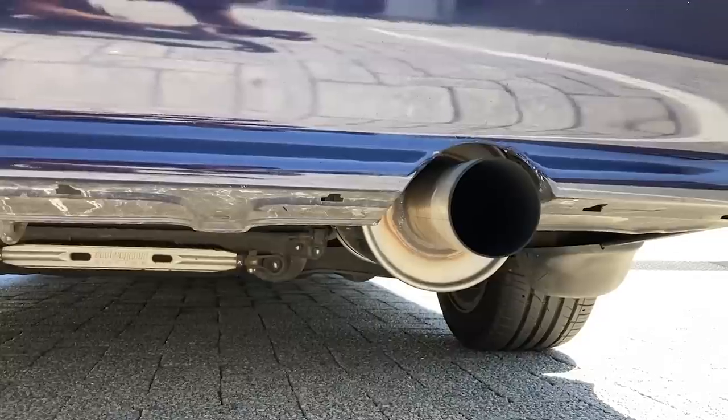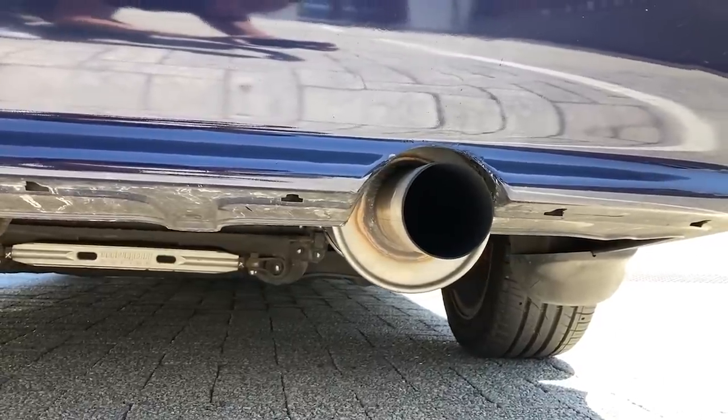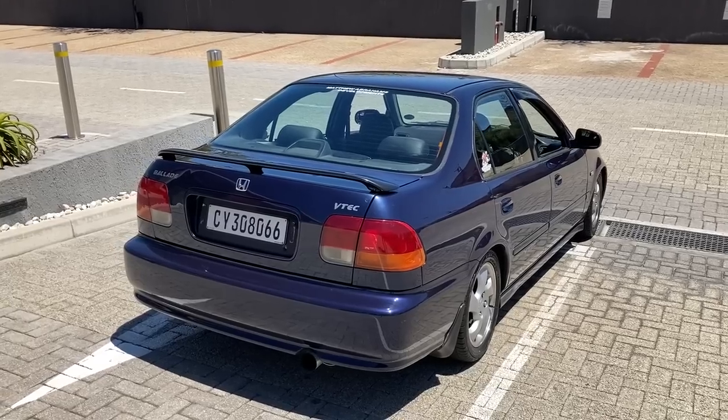Spinning, and that's a thumbs up for Z-Line. I took the car to Harith GSD and he did my road tune. So after my road tune, I fitted the speed box and I went for a power run again. So the car was doing 134 kilowatts, and it gained 4 newton meters of torque. So it was 134 kilowatts on the power run and 223 newton meters of torque, which is pretty good. I'm happy with the figures. Very happy with the figures, yes.